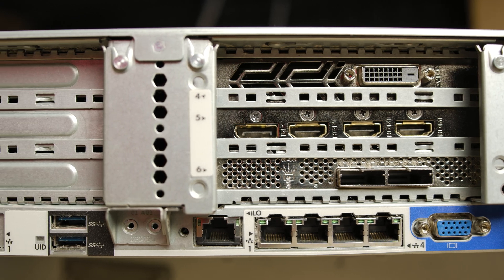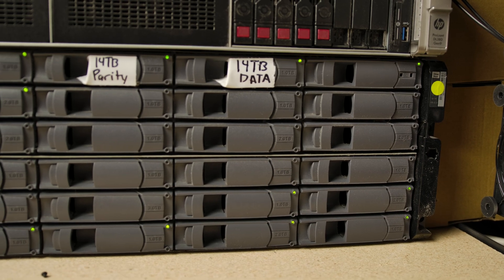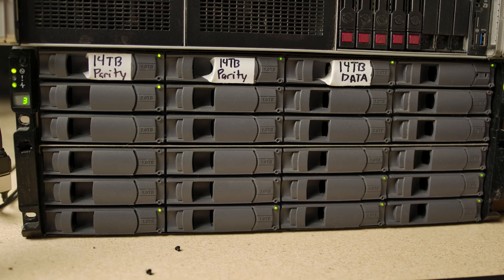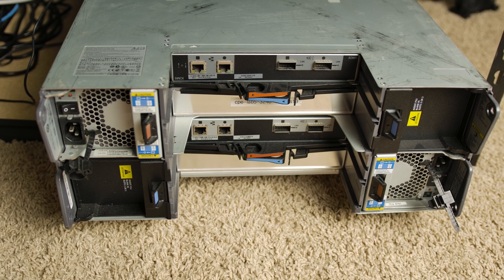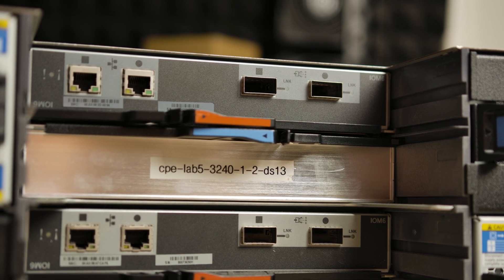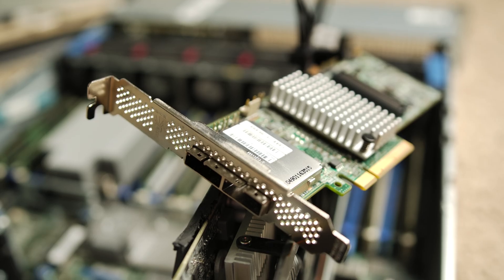There's not any room in here for all the 3.5-inch drives I use for my storage. Instead, I have a disk shelf where all the hard drives get installed. Just like the server, I found this one on eBay, and ended up with a NetApp DS4246 unit. It has room for 24 3.5-inch hard drives. Like the server, it has redundant power supplies that can be hot-swapped in the event of a failure, but on the back, you probably won't be as familiar with its ports. The one I used to connect to the server is a QSFP port, so I picked up a QSFP-to-MiniSAS cable and got a dual-port SAS card to install on the server. The connection with this disk shelf will be limited to 6 gigabits per second, which if you're editing raw video off the server could be a limiting factor, but I tend to edit off a local copy after backing everything up to the server, and then transfer anything else I need over before removing a local copy.